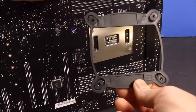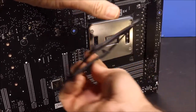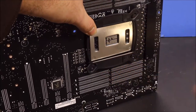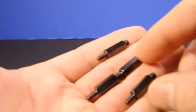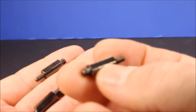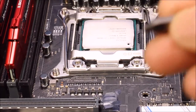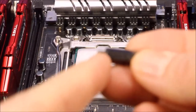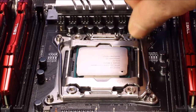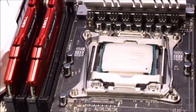For this step, take the backplate for the water cooler bracket and align it with the four holes on the back of the motherboard — those are adjustable, so pop it into the four holes. Then flip the motherboard back over. For the LGA 2011 socket, you're going to use these standoffs — they're long on one side and short on the other, four of them total. Put the short end into the motherboard and firmly tighten it down.